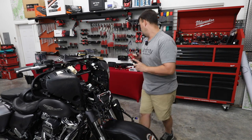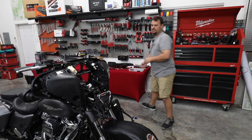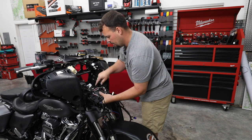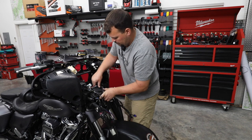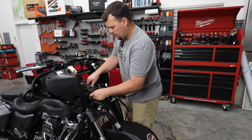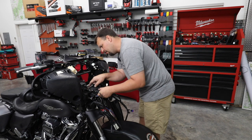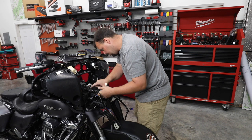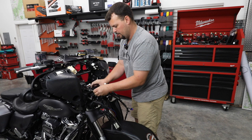All right, so those three bolts are now tight. It's time to move that tray back into the position where it used to be with all this wiring. Again, just being mindful of the wires and that we don't get anything caught or pinched. I'm just gonna feed it back in where it goes. If you pay attention, at the back of this plastic plate, there are two little ears that stick out, and they feed into a metal channel. Once you get those lined up, it's going to let you go all the way into where you can put your clips back in.